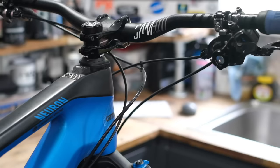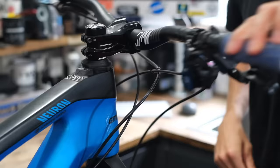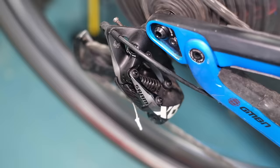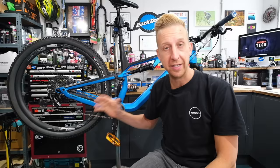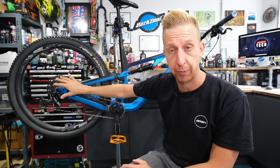Now have a sense check at the front end. Make sure the cables and hoses are all long enough that your steering is not constricted and none of them are pulling on anything. If any hoses are being crimped or kinked adversely, that will hamper your gear shifting and brakes. Also do a quick sense check around your transmission — make sure the cranks rotate freely and there are no stiff links or obvious damage to your chainring, chain, or rear cassette. Assuming this is all good, let's get started.